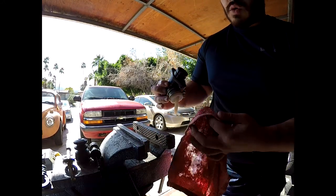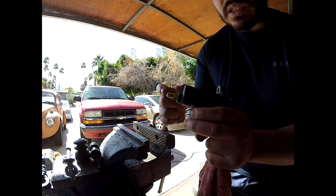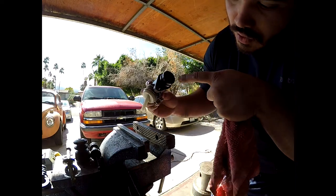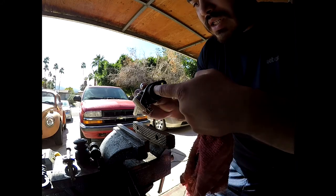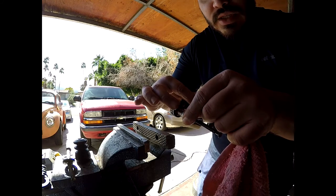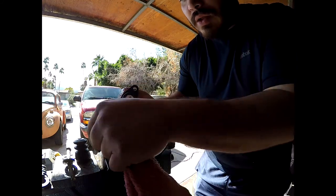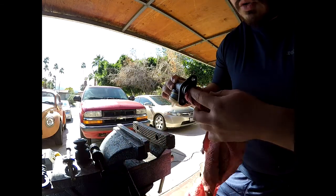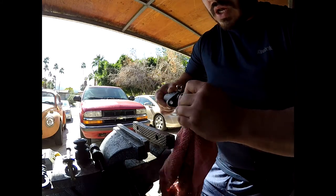That's essentially what you have — it's just an O-ring on the inside. The outlet is right over here on the back of it. On the very back there's a hole, so every time you push in that plunger it creates pressure. Once the opening reaches one of these portions, the fluid will be under pressure and come out of that hole, which will essentially push in your clutch pedal — and that's what makes it hydraulic. Now I'm going to get this cleaned up and then show you how to put it all back together using the new parts.